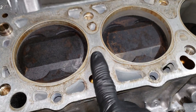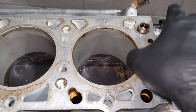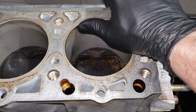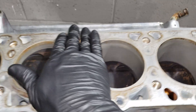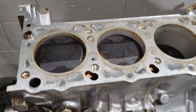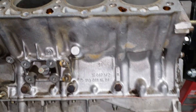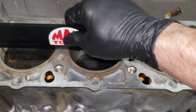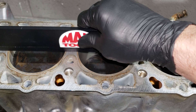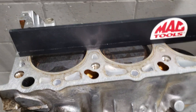After that I went over it with a rag and some brake cleaner, and I cleaned up some of the inside too. You can't really feel any buildup — it's not sticky, not built up like it was. So now I'm going to show you how to check the block for warpage, which is what the straight edge is for. First, you want to check right down the middle — just put it right across like that.